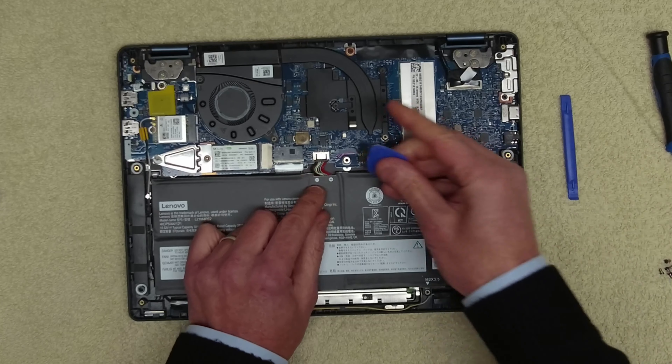We've got a speaker over here, so we're just going to unplug that. Next thing is the fan — let's go ahead and gently get this out as well. That's difficult — there we go. So that's the CPU fan. I'm just going to remove the two screws holding it in, taking it out completely. There we go, so that's the fan removed.